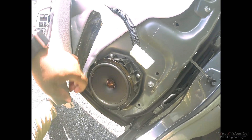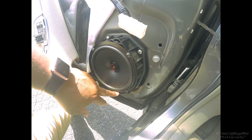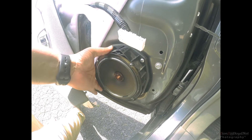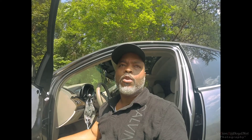The adapter has slots that hold it fairly well. When I get home, I'll probably take it back off and drive screws long enough to go all the way through for a solid hold, but it's on tight and not vibrating, so I'm pretty cool with it. The sound is a little lower, which is expected — this is a 4-ohm driver and the door speaker was a 2-ohm driver. I'm not too worried because I'm going to be putting an amp in here soon anyway, and I can also wire it in parallel to get the right load. Pretty easy overall — I'm going to repeat the other side and then tackle the center channel next.